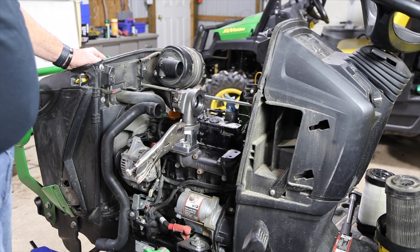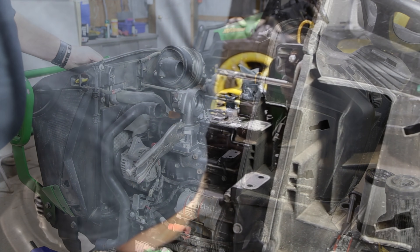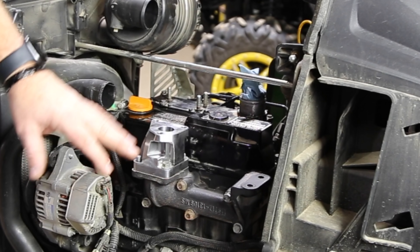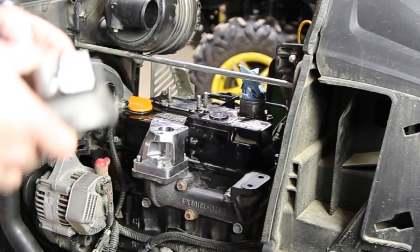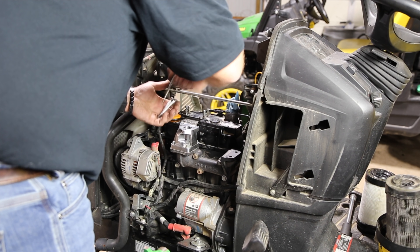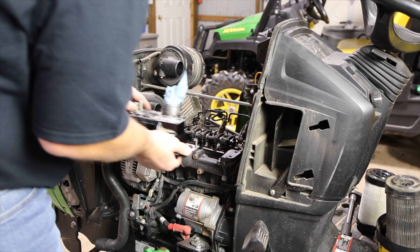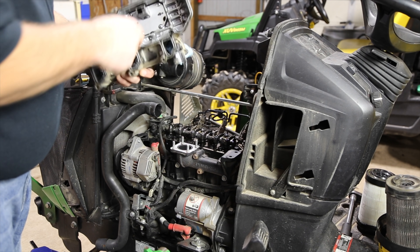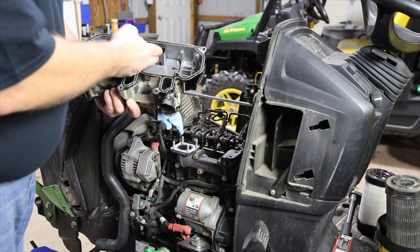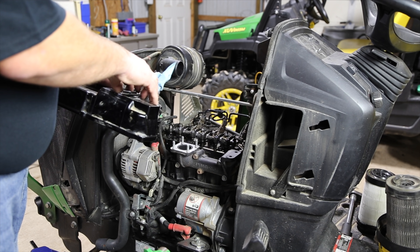Let's go ahead and take this turbine housing back off, get the valve cover off, and then take it back to the machine shop to see if we can get some things done. For those commenting on the first video: we are going to put a pyrometer in here, but we want to get it pretty close to done first so we can figure out where there's room for the pyrometer probe, at least for testing on the dyno. Be careful when you do this at home - some of these bolts are longer than others. There it is - inside the valve cover. We need to address this baffle when we go in with our oil drain, but there's enough gap that we may be able to get around it. May have to move it over, but that's it for now on this side.